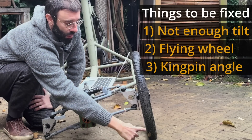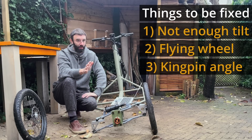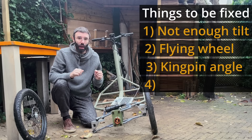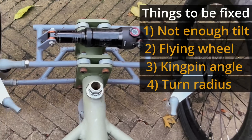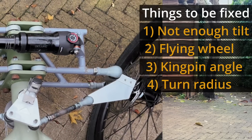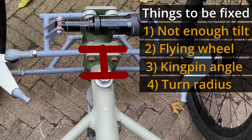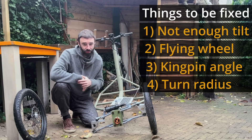The trick to do that is to raise the knuckle in relationship to the axle. That will allow you to make a smaller angle while still making scrub radius equal to zero. And there's a fourth — I was counting on three improvements, but then the axle broke, and that was kind of the fourth. I want to improve the turning radius. What I think I have to do is to reduce the distance between the front axle and the turning pivot, because when these align, that's the end of the steering. By approaching these two points, I think I can turn more without finishing the range of the steering. If you have better ideas, I would love to hear about it.